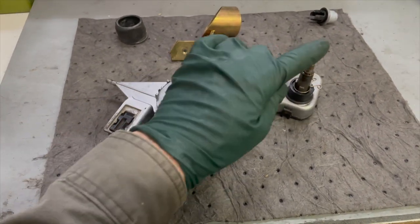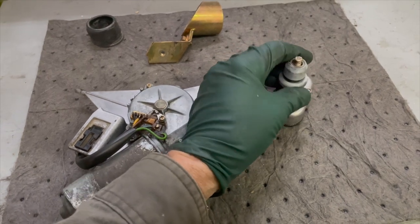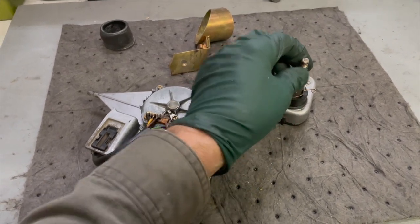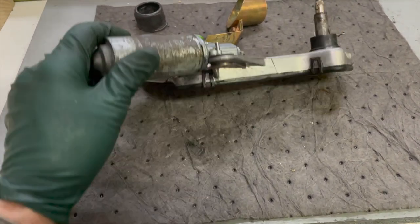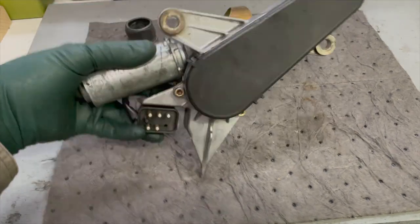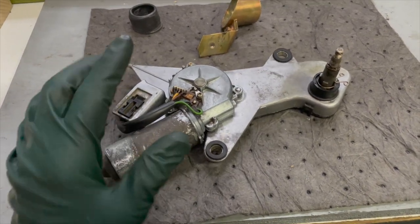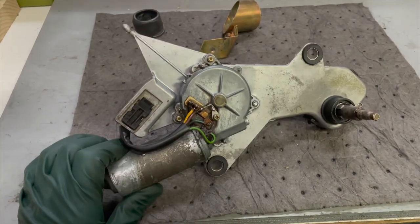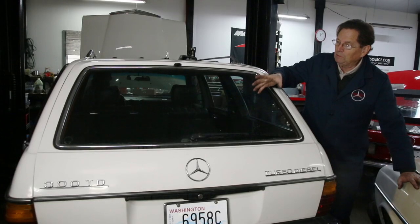If you particularly drive in a lot of rain, moisture can get down through this shaft. You'd think this seal would seal it totally, but over time water gets down in there, causes corrosion, and causes the shaft to start to drag and eventually bind. I took about three of these apart and actually fixed a couple to resell. I did a complete instructional video on how to take one of these apart, overhaul it, and lubricate it — that's available on my website. I also have some good units, motors, and brackets for sale, so check out the links below.